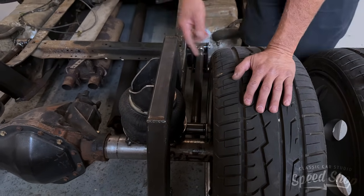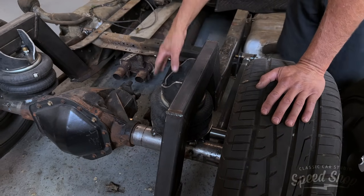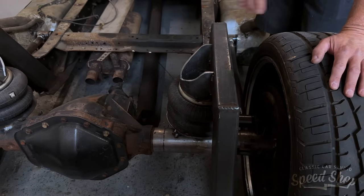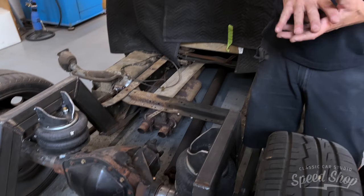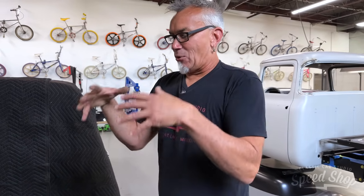Off the house air compressor, this thing airs up and down and lays frame — it airs up fine. The problem is we're limited on lift with these bags. We're going to try a different bag to get more lift. Even though we're going to ride low, this truck is so long that if you high-center on a bridge or ridge getting into a gas station — especially with a big trailer — you're causing a traffic jam. With a quick bag change I can get more lift to clear anything. So the idea for today is to swap out the bags, burn the mounts in.